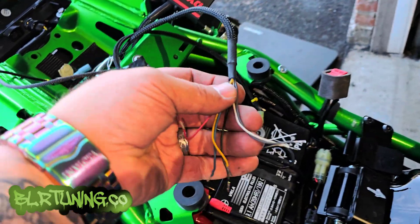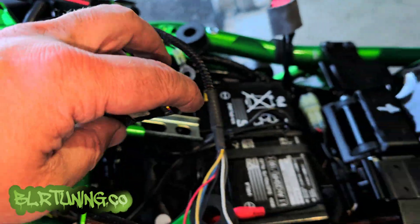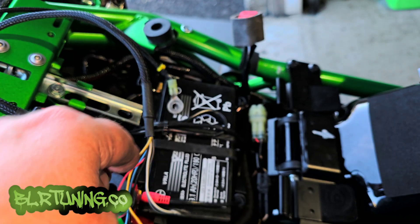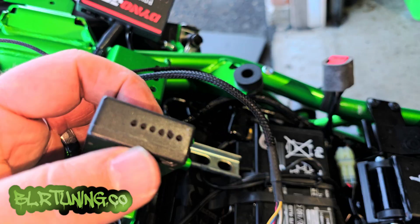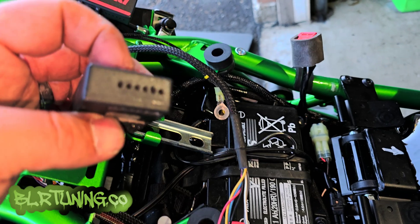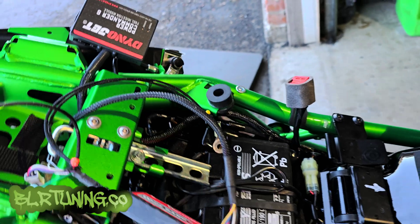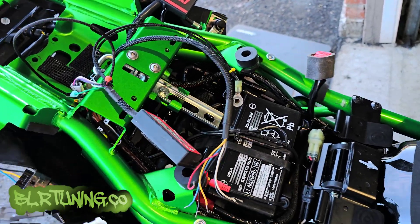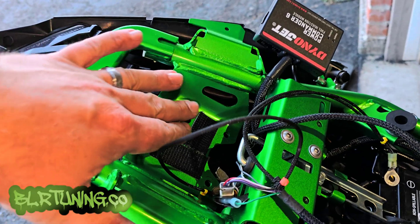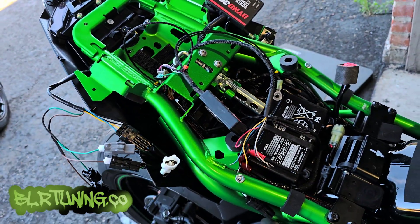You'll see the color-coded wires for your six-wire Bosch O2 sensor. Poke those in through the holes, use the little flathead screws and screw it down tight, give each one a little tug to make sure it's connected — that'll be for your wideband O2 sensor. Our wideband will be sitting back here with our Power Commander, all nice, and we'll get all this wiring tucked out of the way.